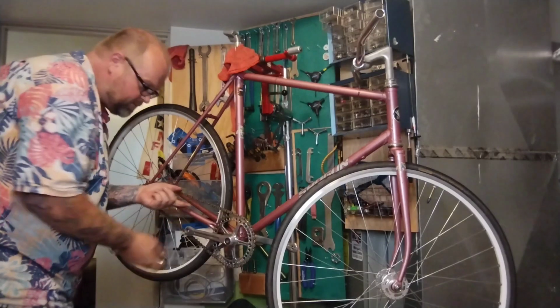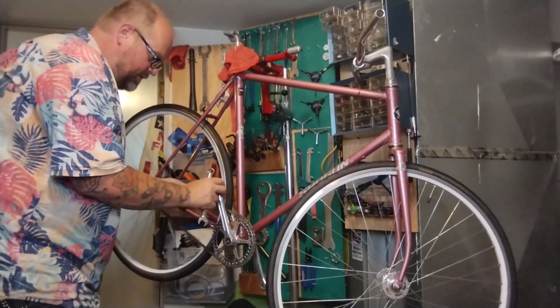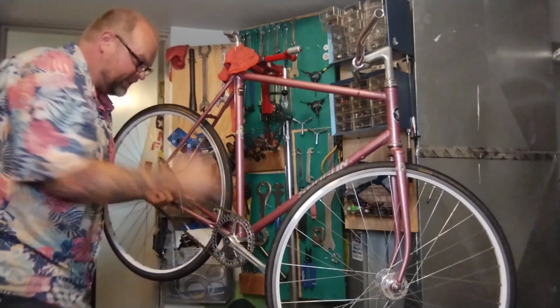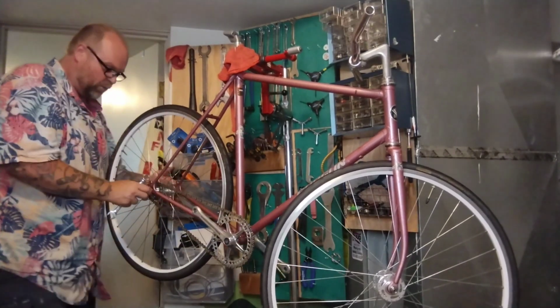Pretty tight. So we lucked out. It was about where the crank was aiming. That's about the tightest spot. If you find any spot that's tighter than about a half inch deflection, you need to leave that spot, find the tightest spot, leave it there, and readjust this chain.